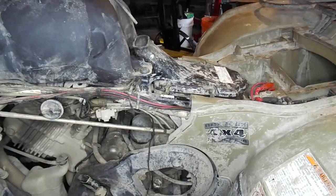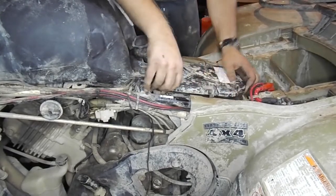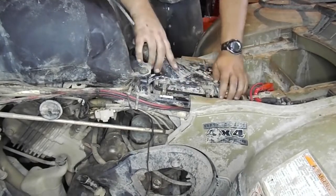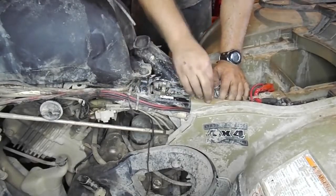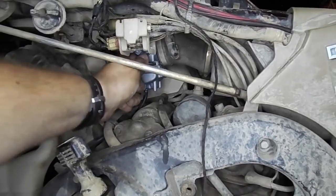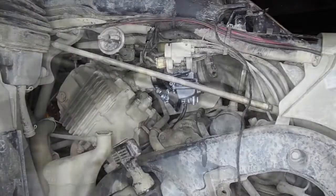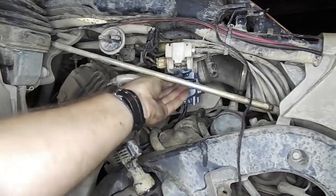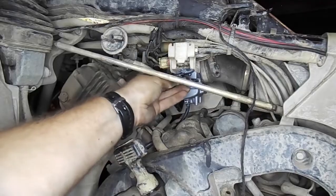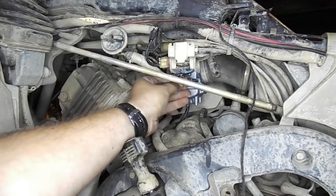After the tank is bolted down, place the lid on the airbox and clamp it down with the metal clamps on the airbox. We now need to connect the fuel line from the tank to the carburetor. Take the rubber protective cover off the carburetor, then take the fuel line and slide it onto the carburetor. Use a set of pliers to pinch the hose clamp and slide it into place to hold the hose tightly on the carburetor. Then follow the same process connecting the hose to the tank located right behind the fuel shutoff.